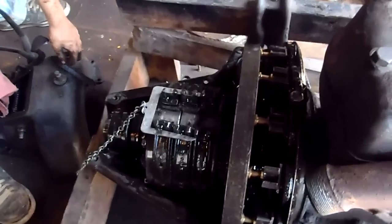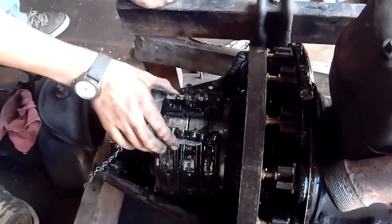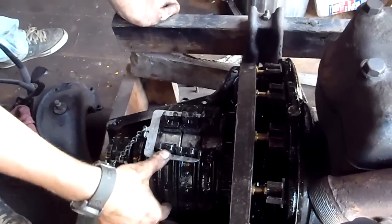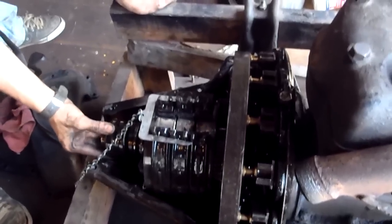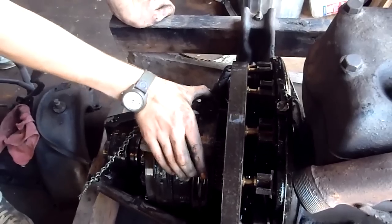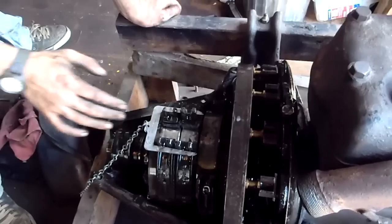Why don't you explain a little bit of what we're looking at. So you see we have this holder in here, and there are three bands in the transmission: reverse, low, and brake, which stops the whole assembly. And then we have this stack of clutches here for high gear. You push in the low pedal to start off, and that squeezes that band and puts it in low.